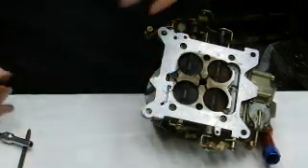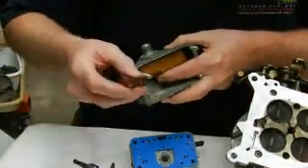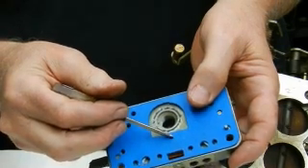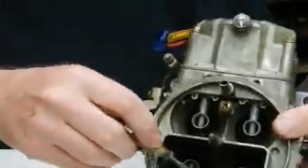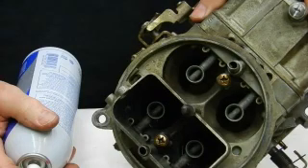Here's the bowl and here are those two holes at the diaphragm. The fuel when it's compressed comes out right here, goes through this hole through the meter block, then comes up the meter block and out the center hole right above the power valve on the meter block. It comes out these discharge holes on each side — one on each side, both front and back.